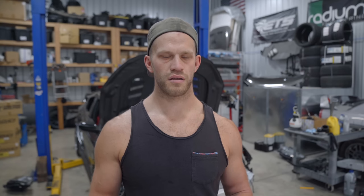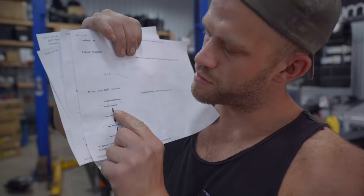Here's what we're going to do to try and resolve this issue. I have realized I've been bleeding them wrong on pretty much every car I've ever bled. You start at the right rear, hit left rear, then right front, left front - that's what I've been doing. Now on AllData, it says the process is the exact opposite: front driver's, front passenger, rear passenger, rear driver's. Then you apply and release the parking brake five times and bleed the rear brakes again. Air can get trapped inside the rear calipers due to the complex fluid path inside the electric parking brake calipers.